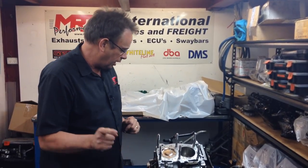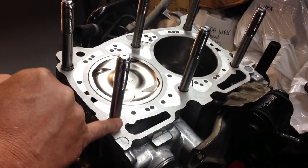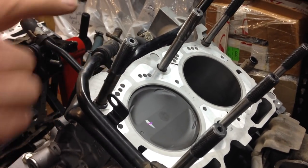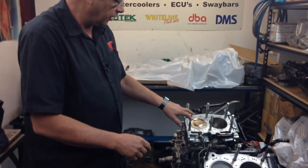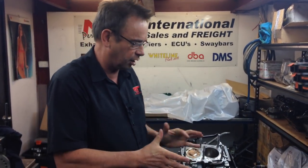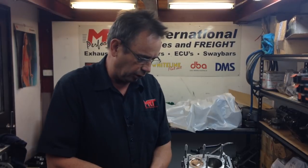When you're looking for options and upgrades for your package, these are things you need to consider. One last thing I want to show you: this new set of head studs we're using now are even thicker on their main shaft right up to the thread, whereas these 14mm head studs are necked down a little bit — different brand, different design, different feature. These are the ones we're starting to use now, a slightly newer design. All three of these engines have separate videos because we're doing a lot of engines, and this is a fantastic opportunity to share the differences between these components when deciding on performance upgrades — whether you've got an early model car going for a bigger 2.5 litre upgrade or going for a lower-cost short block replacement out of the crate. This is an engine we're building for a client interstate.